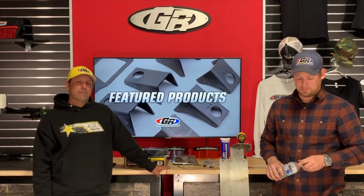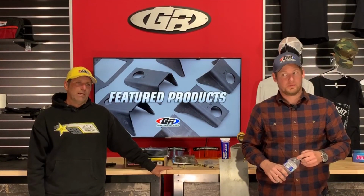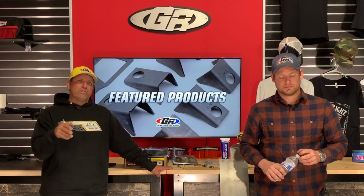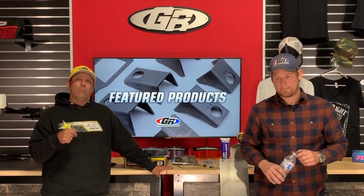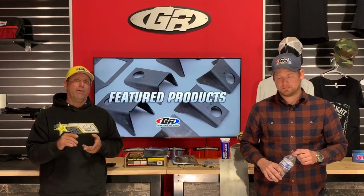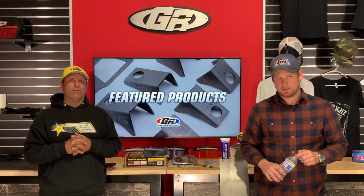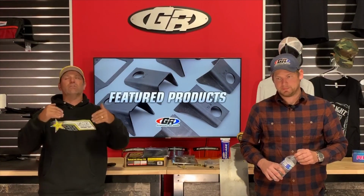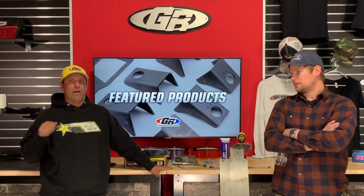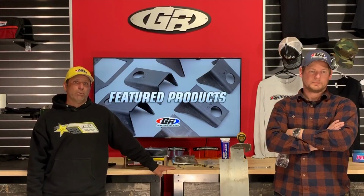Jacob Klink asked, can you put a manual valve body on a stock 3.6? I don't know of anybody that's tried that. I know that the 3.6 has a manual mode, and when I drove Shane's JK and a JL in Moab, by putting them in manual mode, they were way more drivable. If you drive that in drive, in low range, that thing is herky-jerky. It's trying to shift every 10 feet. I don't recommend that at all. You definitely want to use that manual tap shifter. So, yeah, super important.